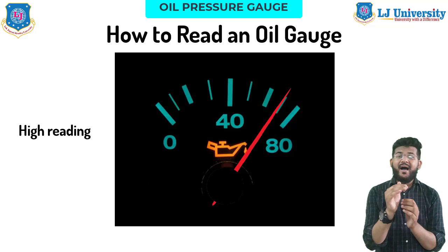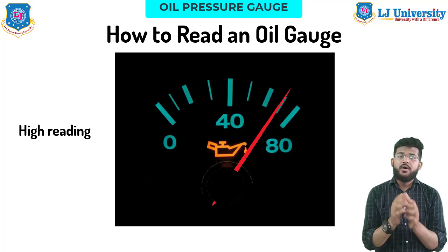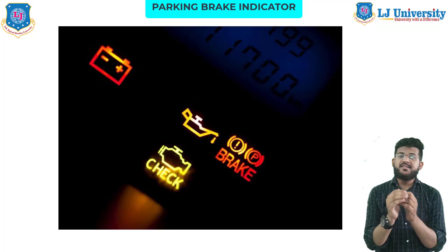Third is a high reading. The needle on the pressure gauge should settle at the midpoint after the car has been running for about 20 minutes. If it settles towards the top or higher side of the gauge, it could indicate high oil pressure. The pressure relief valve could be stuck or faulty, or there could be a blockage in the oil delivery lines. Since high pressure could cause your oil filter to burst, switch off your engine as soon as you notice this high reading. Your car's gauges, indicators, and lights are made to help you and clue you into issues before they cost you significant time and money.